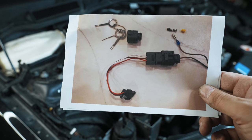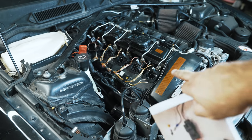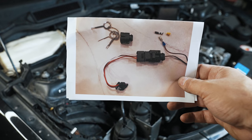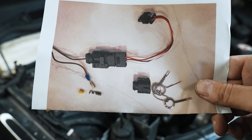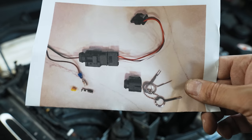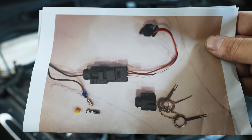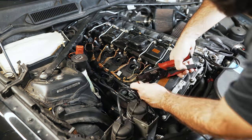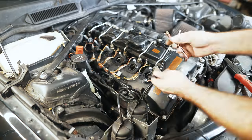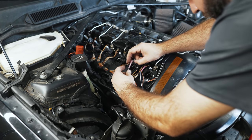These connectors are already pre-cut for you. It's worth mentioning that the developer of this kit is working on a plug-and-play solution that will just plug into your factory harness without cutting. The direct connection is probably the cleanest with the fewest failure points, but this splice method is a good option if you don't want to hack up your factory harness. It would involve depinning your factory connector and moving it over to this square-style connector - the kit gives you the depinning tool you need, so you can keep your wires intact and just snap it into the provided adapter harness.